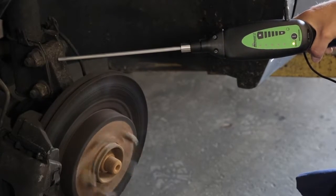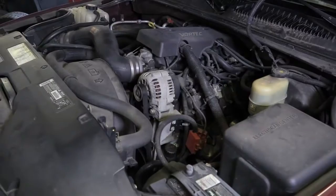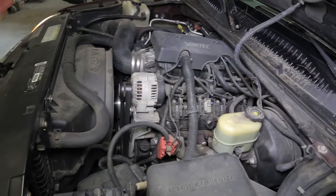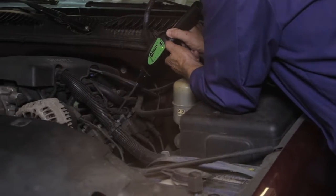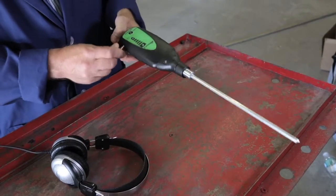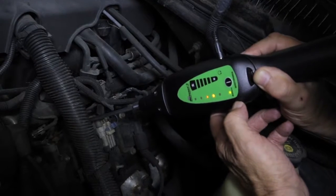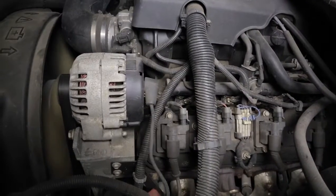Most of today's fuel injectors and solenoids are switched on and off by an electronic control module, but that doesn't mean a command from the module will cause an injector or solenoid to respond — especially if there's a mechanical or electrical issue. This vehicle came in with an intermittent misfire with no hard trouble codes stored. Screw the contact probe into the nose piece, put the headphone jack into the receiver, put on the headphones, turn on the receiver, and adjust the volume. Touch the tip of the contact probe to each of the injectors. This injector isn't firing — further investigation showed a damaged terminal in the injector's connector.